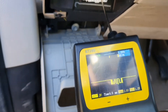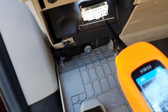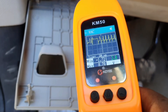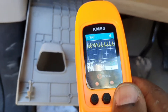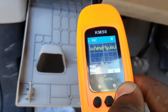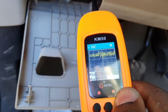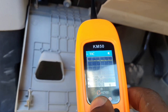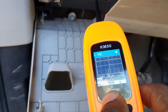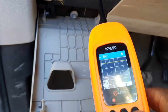Switching to the KM50 — it has a voltage AC function which gives you something similar, but you can see the difference. At a division of 20 it's not very clear, so I'll raise it to 50, then 100. The waveform looks a bit strange on this tool. If you need to check a square wave, I'd definitely prefer the BT-280's dedicated oscilloscope function. This same AC volts function is also available on the KM10.